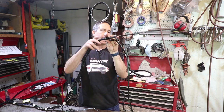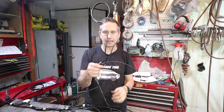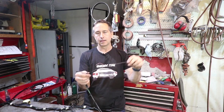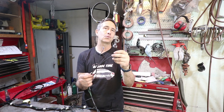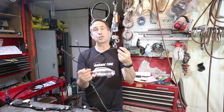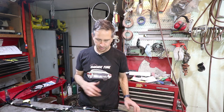Out with the old and in with the new. I was able to get that new wire strung all the way through — here's the wire on the engine side, left long since I'm not sure exactly where the coil is; I'll cut that later. I ran a black wire through — the one I took out was black-white — so most of it gets covered up, but I will use a paint pen to trace the white stripe around the wire to make it look identical. It's the exact same size wire, 2.5 millimeter, which turns out to be 14 gauge. This is SXL wire with a slightly higher temperature rating and a slightly smaller sheath, so getting it in was no problem — getting it out was a little difficult, which is where I had to cut multiple places in the sheathing to help fish it through.